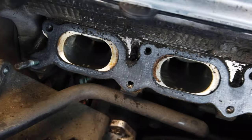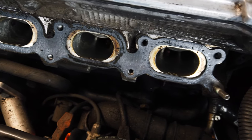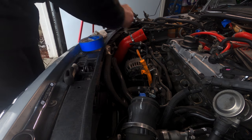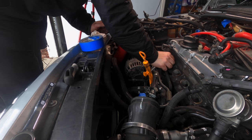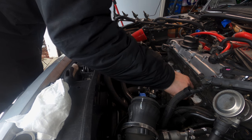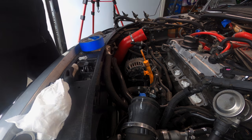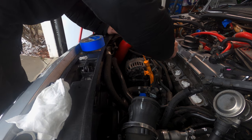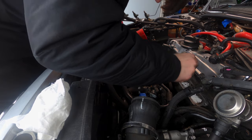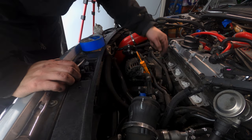The great news is that even though the manifold was in terrible shape and was leaking, there's hardly any carbon buildup inside the engine itself. Pretty quickly after you remove the intake manifold, I suggest you plug these holes as well, especially if you've got any other work planned while you have the manifold off. At this point, this install had gone smoothly — too smoothly. It was now time to move onto the PCV system. We've replaced two of the three main components of this in the past, and we really only have the last hose to replace. Too bad this car has an evil tendency to save the best for last.